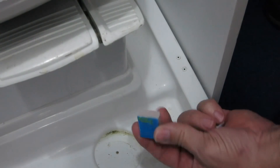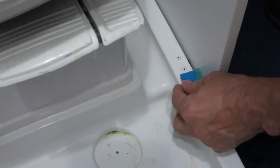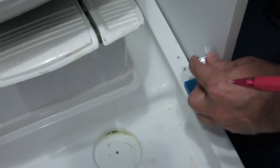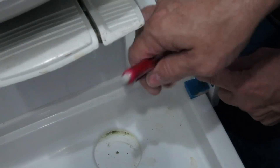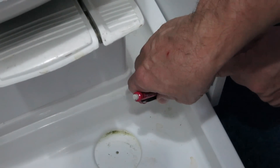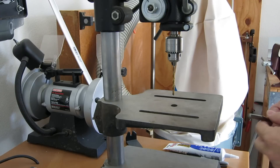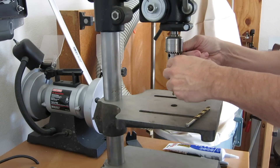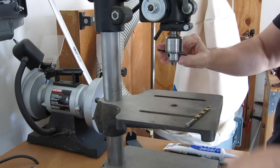On the inside of the door, I'm taking that piece of plastic that I had fitted with some tape and stuck it on here. What I'm going to do is just go ahead and trace around where the bolt goes into it, so I can have a reference of where I'm going to drill a hole. Then you switch out the drill bit to one that's a little bigger, because with plastic it's easy to split or crack it if you just try to go all in one shot with a large drill bit.